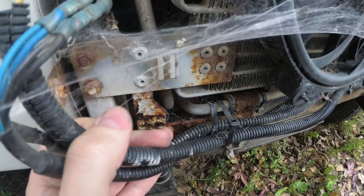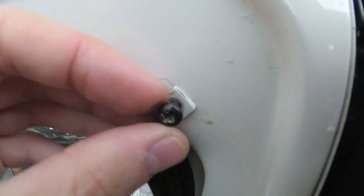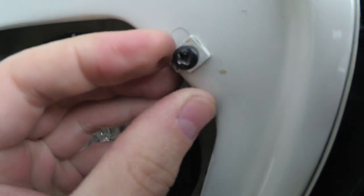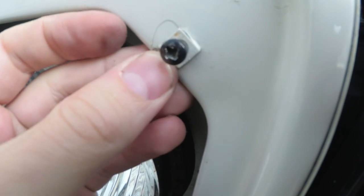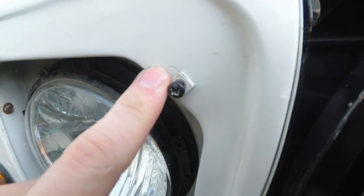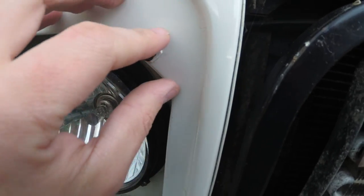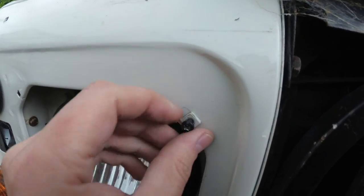Here on the wing, at the front of the wing next to the headlight, we've got these plastic lock nuts. These are black — normally they're plastic — and this has been resprayed over. There you can see a bit of the paintwork just flaking off slightly with the original paintwork underneath. You can only check this by taking the front plastic trim panel off — then you'd be able to tell, because they're very easy to take off. It would be a pretty poor paint job if they tried to mask off around this plastic trim on the headlight panel.